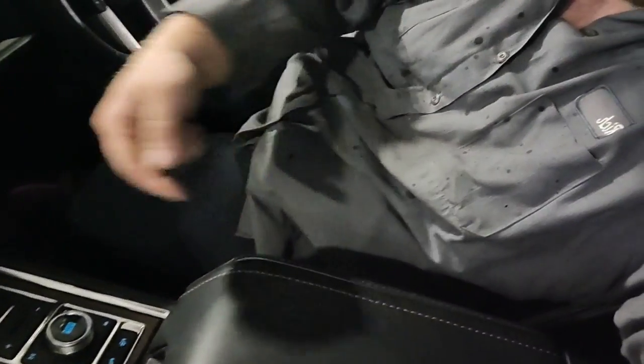Sometimes it's kind of difficult to get in here. A lot of them say you can actually go right underneath this area and gain access to the plugs. In this particular system it's not that easy to do. What I ended up finding is under the driver's seat there was a bad connection going from the driver's headrest, which then transfers the video over to the passenger side. You track the wiring down across the center console — there's a connector in the center console — and then go underneath the driver's seat.